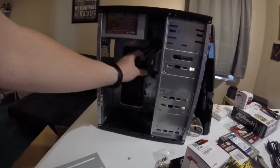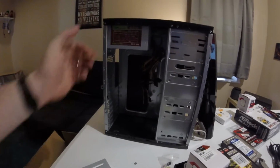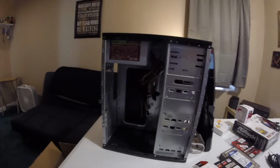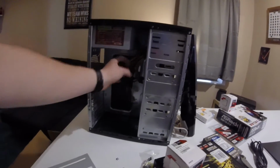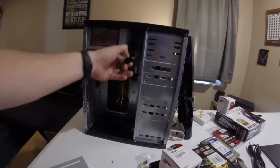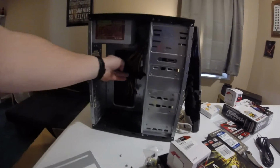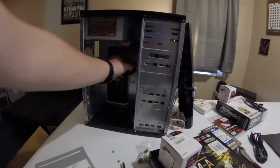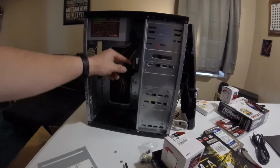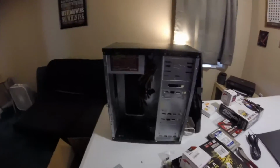And now I remember. I'm not using this power supply. I put this power supply in an old computer, and I put a different one in the computer I'm using right now. But I remember I ran into that problem. I was wondering why I had an 8-pin power supply and had no 4-pin for the CPU power, but I wasn't paying attention. So this is actually 4+4. They come apart there.